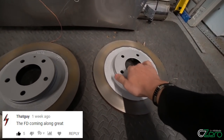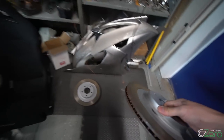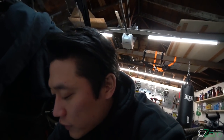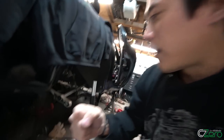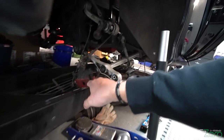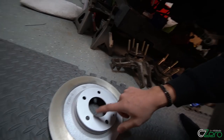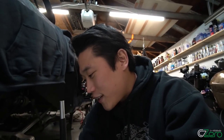Now another thing is the rear rotors. These are oversized rear rotors from a 1999 FD RX-7 — I think it's the Spirit R or RZ edition — basically a special edition that was only available in Japan. These are 314 millimeters, which is about 20 millimeters larger than stock FD RX-7, so this is the only JDM component on my car. When I took off the rotors they were destroyed, so I started looking for a new set online. These rotors are literally like $450 a set — that's the cheapest I could find anywhere. Luckily the old rotors had enough material to be resurfaced, so I had them turned and repainted the center portion. At the same time I found a new set for about $250 shipped on the forums. So for those who want to go 314mm rotors in the rear — just a quick caution that when they wear out, you're going to have a hard time finding a replacement set and it won't be cheap.